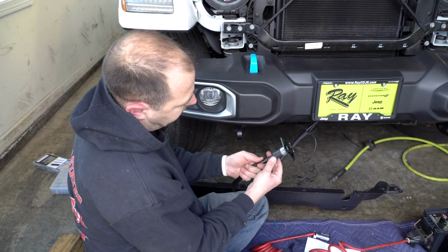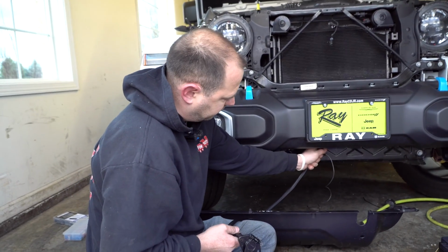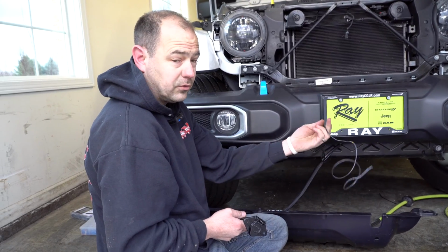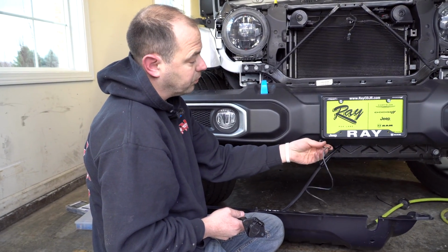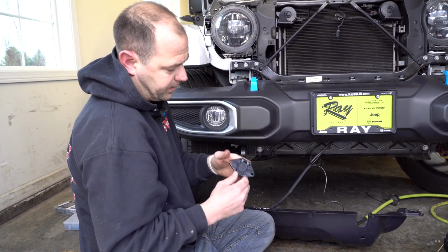So we got our heat shrink on here. I just wrapped it with a little extra tape. Everything's all in its loom. I'm going to finish that up. We're going to do our chassis ground up there. If we ever want to add an additional style of charger that requires both a chassis ground, we'll be prepared for that.